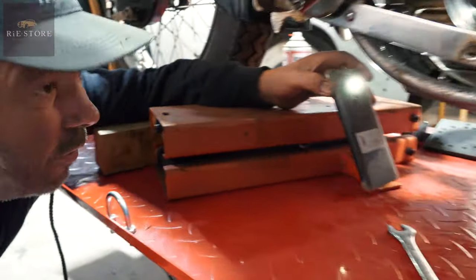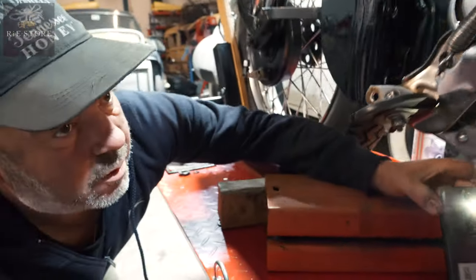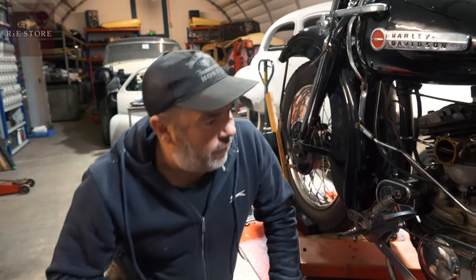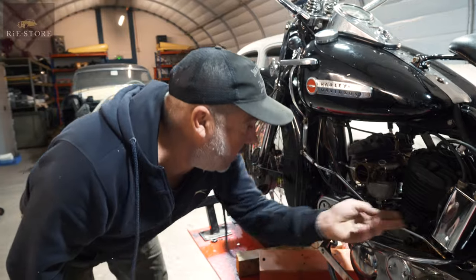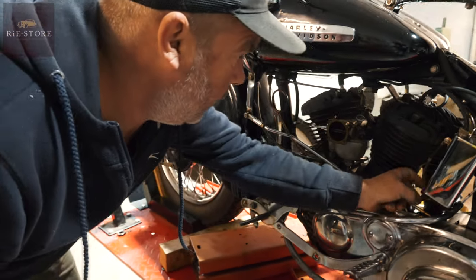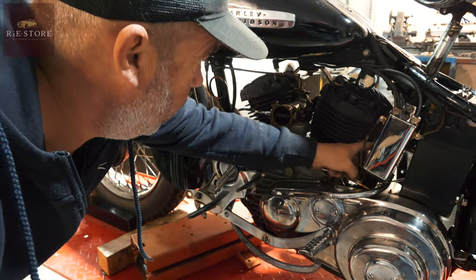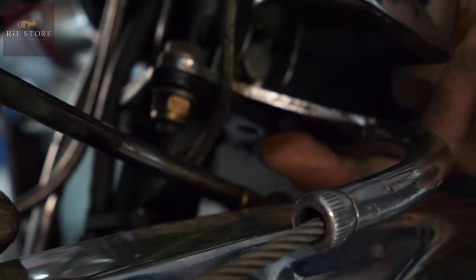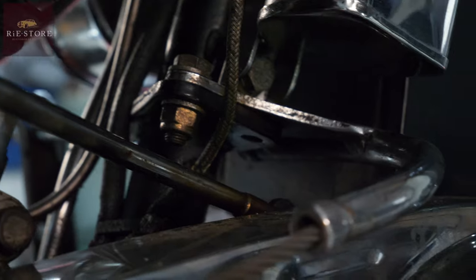The other side — I can't find a number on it — but that's not unusual to have mismatched cases. The other thing that dates it as a 1948 frame is there's a third hole in there. The original just has two bolts to hold the clutch cable, but they've got a third hole in the 1948 which is up under there — you can't see it, but it's up under there.